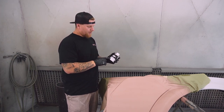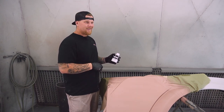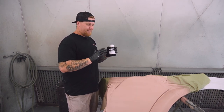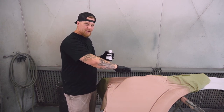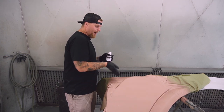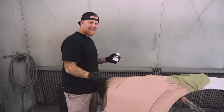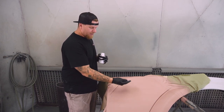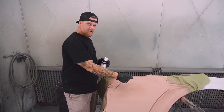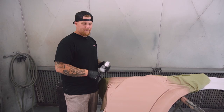We're gonna go through. If you do dielectric with too many coats, you will create a dark spot. So it needs to be three very even coats. If you have areas that have multiple angles to it, you need to try and spray that as even as you can without creating more and more, just like a candy. If you have a candy area that you spray and it's coming too heavy over one panel to the other, it's going to create a dark candy. Same concept, dark lighted area.